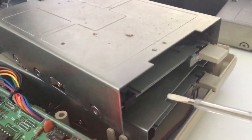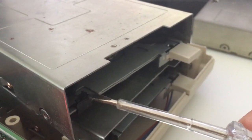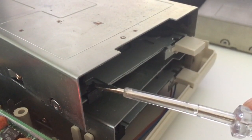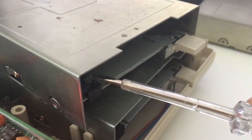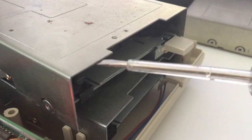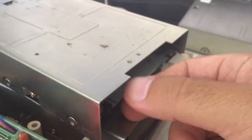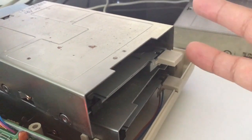The problem on this drive is different. The problem lies in here — as you can see, it's got two black plastic pieces here. This one is just pressed down. I can pull it up, but this is the connection that, when we insert a disc, gets pushed down and tells the disk drive that a disc is inserted, making it spin and read. But this piece is stuck down, so when I turn on the Amiga, it spins for a second and just stops. This part is just dead and very wobbly.